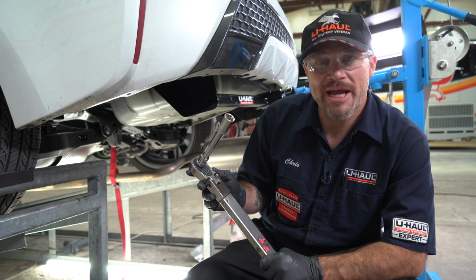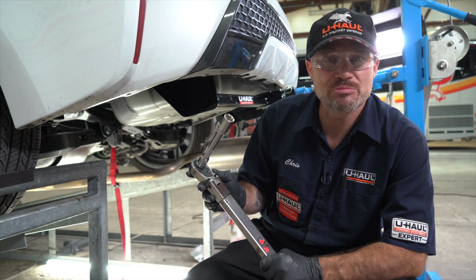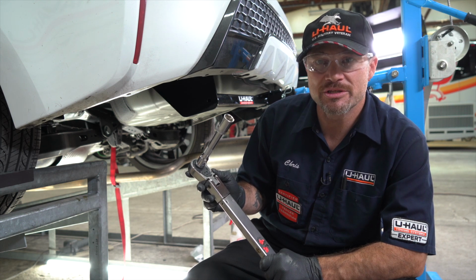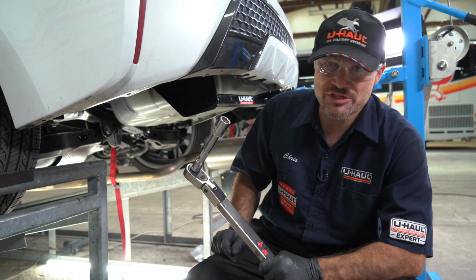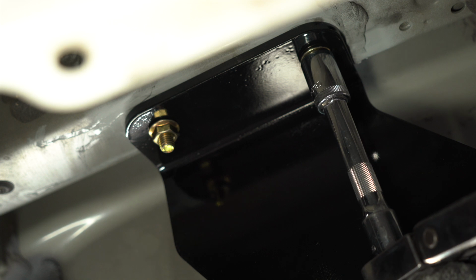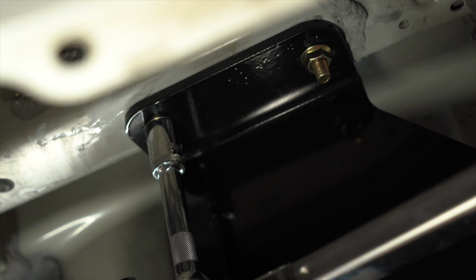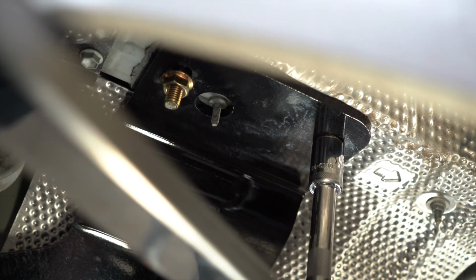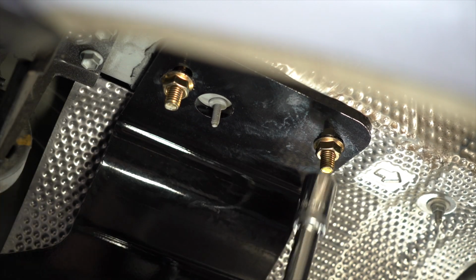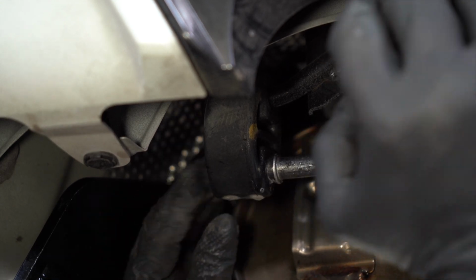We're now ready to tighten and torque the hardware to the manufacturer's specifications. I will link them in the description below. We're going to use an 18mm socket and a short extension to gain access. You can now return the exhaust to its original position.